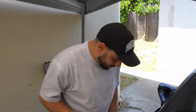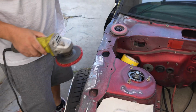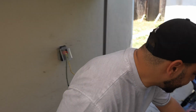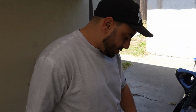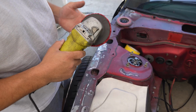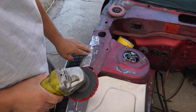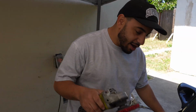Oh no, bro. Alan's gonna kill me. Alan was saying we should just 400 grit the whole engine bay and just spray it, no primer. I'm like, bro, that's not. Look at the texture on this thing, bro. It's chalked. He's not gonna be happy. But also, I think this is doing too much. So maybe not. We're gonna have to seal the whole bay now, and then high build and block. Good thing I tested it here, but this is just a little too aggressive. I don't know if it's the Master Pro or if the grinder's too fast. Bunch of hot garbage. Do not use this.